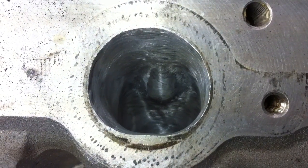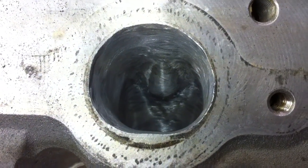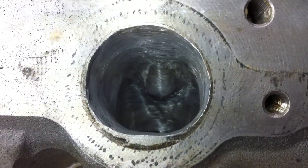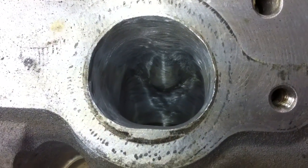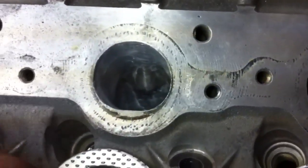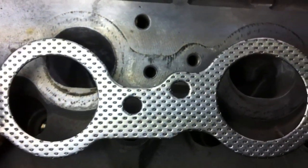I used the stained black as a guide to how much I could take off to go out to the gasket, trying to stay one to two millimeters inside that gasket line. What we should all do when porting is go ahead and get the proper gasket put up to that port beforehand.